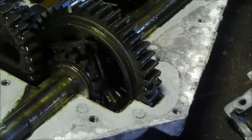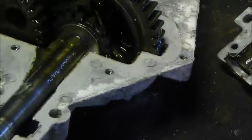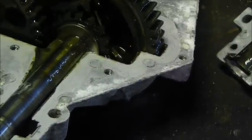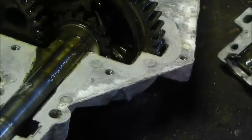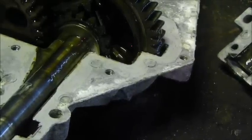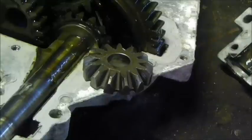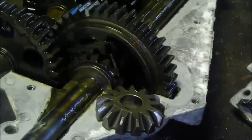And this is the ease lock. You do not need a welder. You do not need to melt any zinc. All you need... let me grab it. Where is one? There they are. All you need is another spider gear. Only one. And basically what we do is we're going to pull out those axles and put it in there, and it'll lock it up.